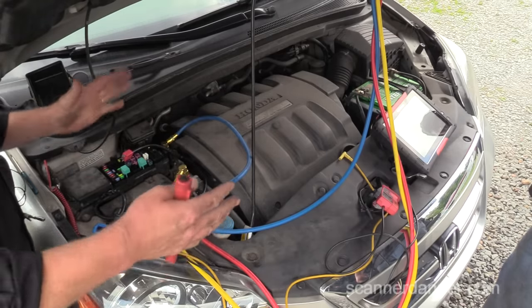I'm using a tool to access that wire because I can't get to the connector easily — it's a piercing probe tool. I'm basically piercing the wire and getting a voltage reading as close to the clutch as I can get. This needs a clutch — open in the ground circuit. What I'm doing is the same test I showed before with my switch: we know our power is getting down there.